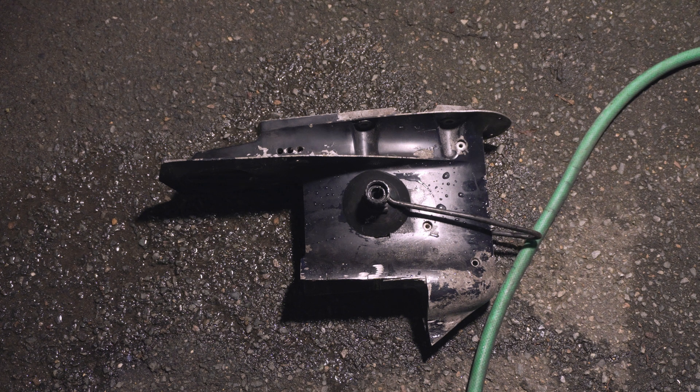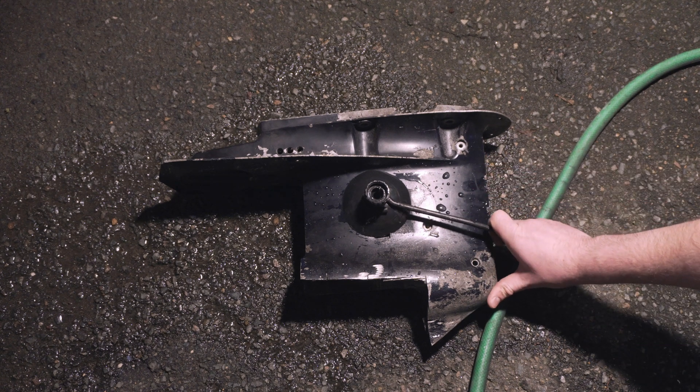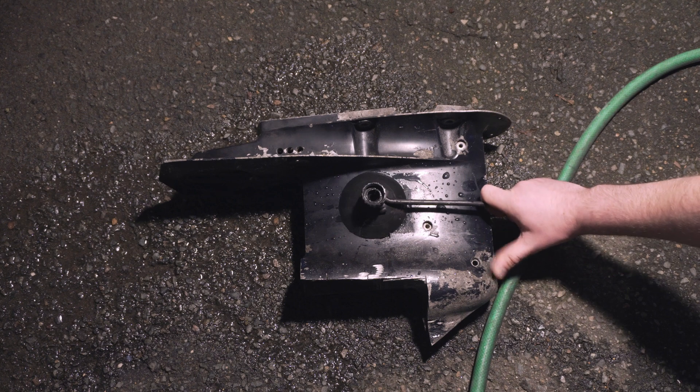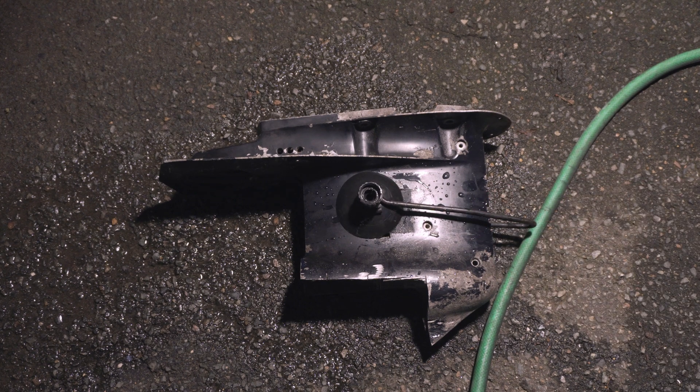You're ready to test your engine. You lift the choke, put it in gear or reverse, and suddenly you look at the engine and it's no longer excreting water. This is because vibration and speed changes can actually cause the muffs to move to the side just a little bit. While you're not paying attention, working on the engine thinking everything's great, you look over and suddenly the engine is overheating very quickly with no water going through it.